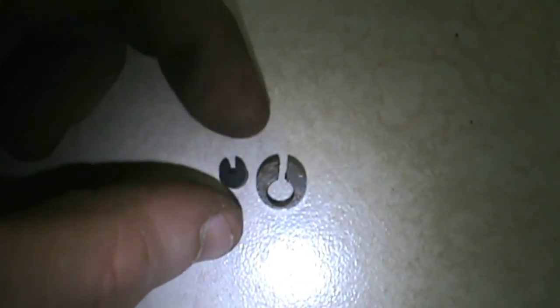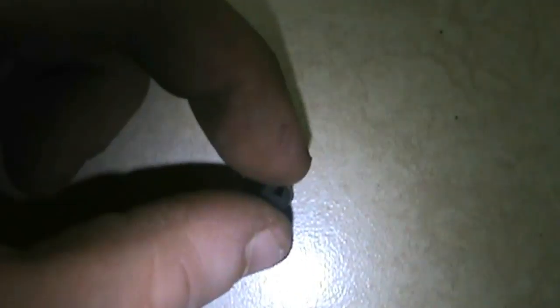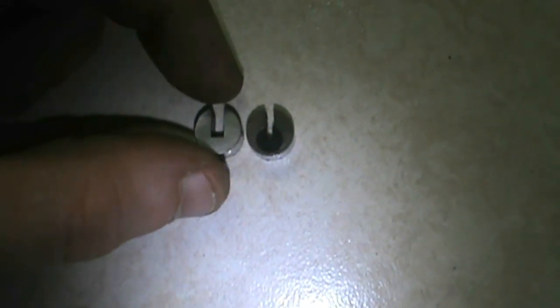This is a stock corner seal — you can see it has a hole there and these little rubber inserts that go in there; these are the older style ones. They also have some that are solid. This type here is what I used in my red car's engine. You can see this one's bigger because I used a 3mm apex seal instead of the standard 2mm.